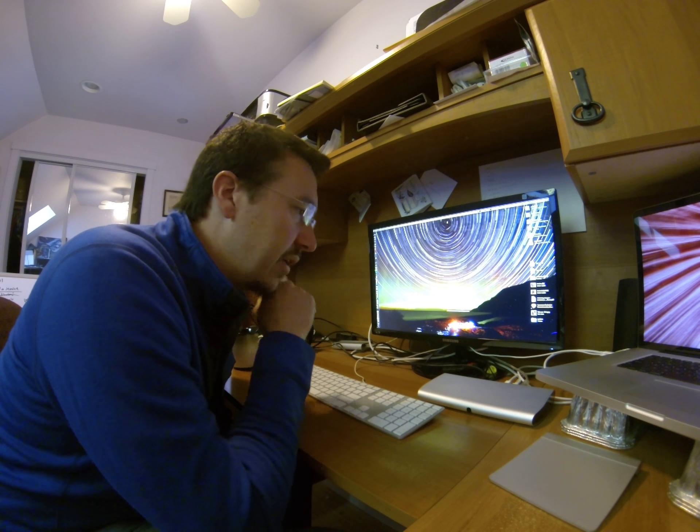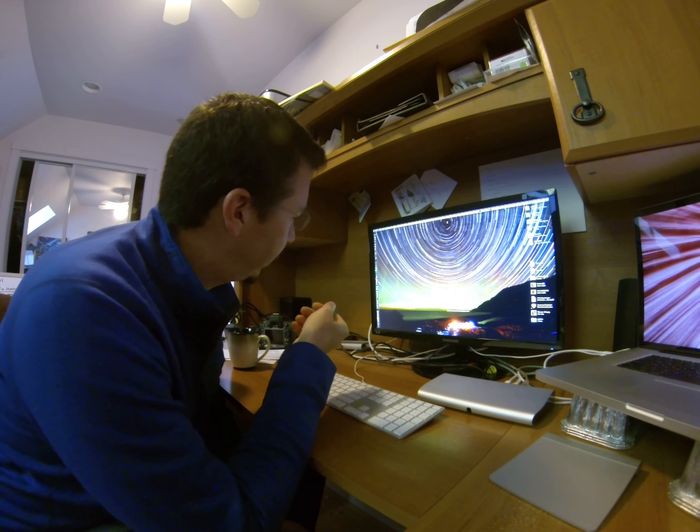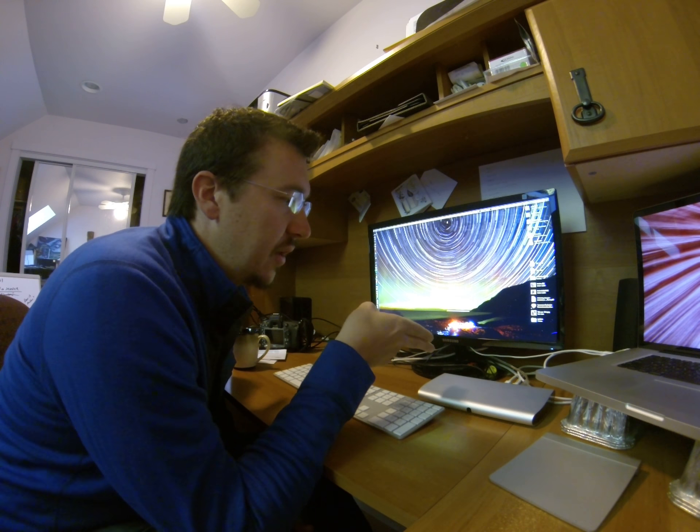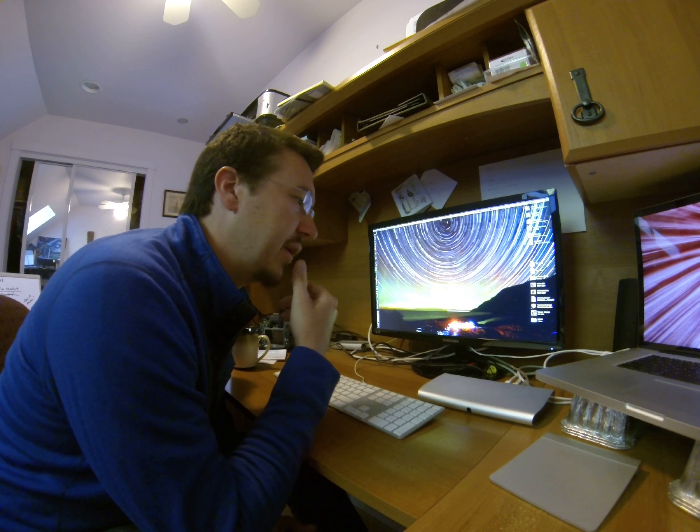The other thing I've noticed is that with those two Western Digital MyBooks plugged in, when I plug the dock in, only one of the hard drives brings up its drives on the computer, which is odd. I have to unplug the hard drive and plug it back in, and it seems to be only one of the hard drives doing this. I tried switching the port locations under the assumption that maybe it has a primary USB port that it likes to fire up first, but that didn't help — it was still that same hard drive not kicking on each time. Again, it might be a function of the hard drive and not the dock, but it's something I experienced and wanted to tell you about.